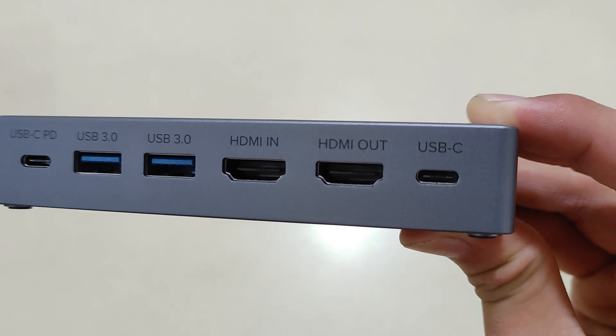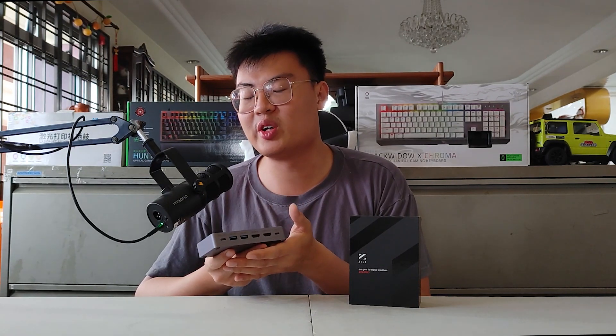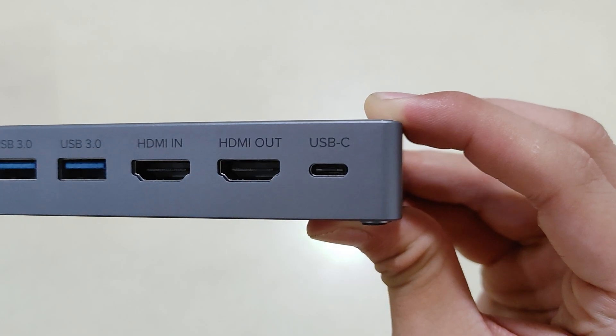On the side there are two HDMI ports — one HDMI in and one HDMI out for passthrough. So if you have a console, it goes into the HDMI in, and the HDMI out goes to your monitor, so you can play your console and view it on the monitor while simultaneously recording or streaming the gameplay. On the right side there's a USB-C port to connect to your PC, so all data captured from your console transfers to the PC for OBS streaming or recording. Very simple and straightforward — you don't need to be an IT expert.